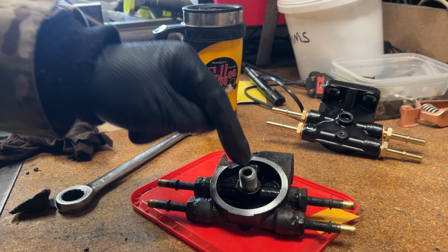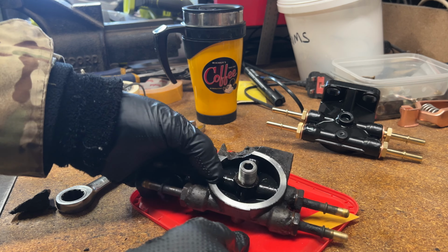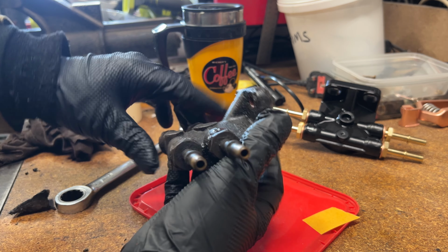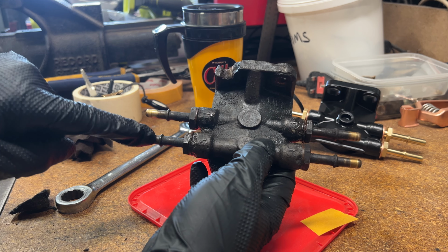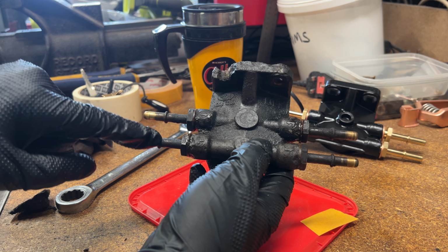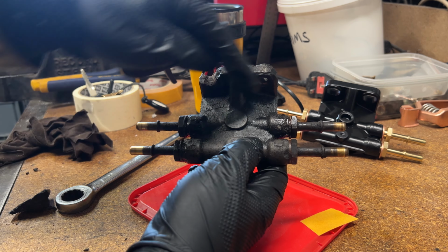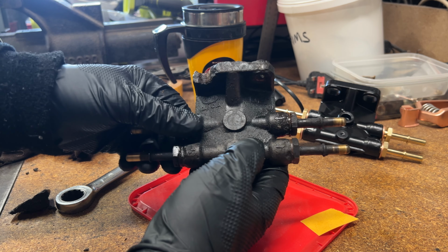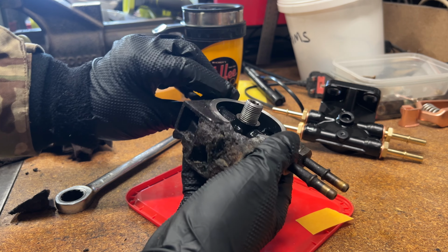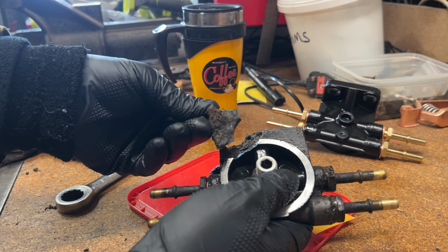Right, just prior to me fitting this back into the vehicle, I've taken those valves out and had a look, and can confirm they're the same, both old and new. So here I have the air bleed valve fitted, and here the one-way valve fitted. When I had the old one in the vise, taking it to pieces, that crack I was telling you about has developed into more than a crack. There's a big lump fell off it.